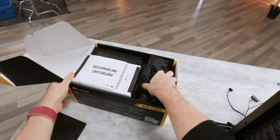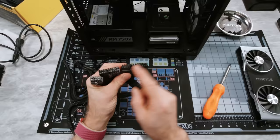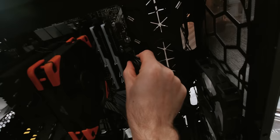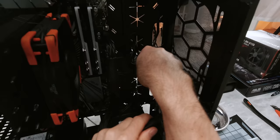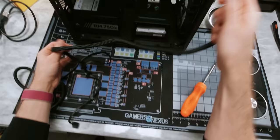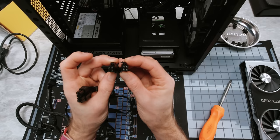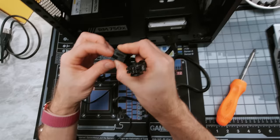Your power supply cables are usually found inside a little baggie in the power supply box. Here are the modular cables we're going to need for our build, starting with the 24 pin — so called for its 24 pins. The split connector is for the power supply end and this is going to go into our motherboard. See this little clip right here? That corresponds to that little clip on the side there. This does require a little bit of force, so if you can, I would recommend putting a little bit of backwards pressure on the back of the motherboard. We're going to go ahead and run this through our cable management grommets. Next up we've got our eight pin EPS connector. You can tell the difference between this one and an eight pin PCI express connector — one is that if it splits apart it'll split into four and four instead of six and two. And many PCI express connectors actually have the gap between two of the pins bridged. Sometimes they helpfully label it CPU.